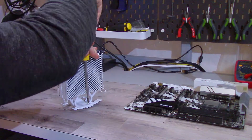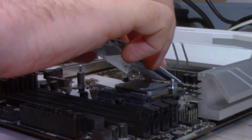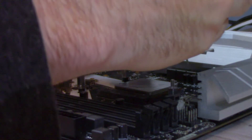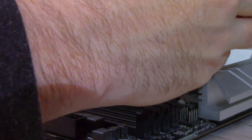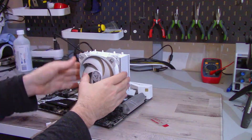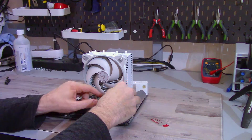Once the mounting bars are fastened to the cold plate, clean off your CPU with some isopropyl alcohol. Then apply the provided or your own thermal compound to the CPU's IHS. Make sure to remove the sticker from the bottom of the cold plate before placing the heatsink cold plate down onto the CPU's IHS. Align the standoff threads with the holes in the mounting bar, then tighten the heatsink down using the four thumb nuts — it's easiest to thread all four thumb nuts onto the standoffs before tightening them much. You can now reinstall the fan onto the heatsink and plug the PWM connector into the CPU header on your motherboard. And we're done with the installation.